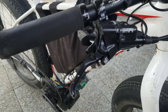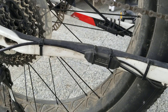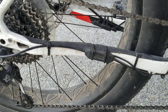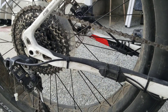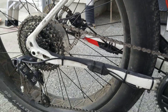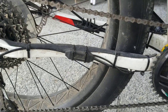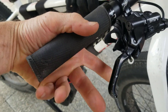You don't really need a brake cutoff, a button cutoff, and a gear sensor, because at the higher levels of power the gear sensor is a little bit useless anyway — I'm only in one big gear, so I'm not changing gear. Even when I did have the gear sensor, what I found I was doing was going off the power on the motor, spinning the pedal a couple of times, changing the gear, and then getting back on the motor power. You don't need a gear sensor to cut off power if there's no power going through the motor. This gear sensor up here — only the slightest movement cuts power, so if you really do need to stop it, you can just do it with one little movement.